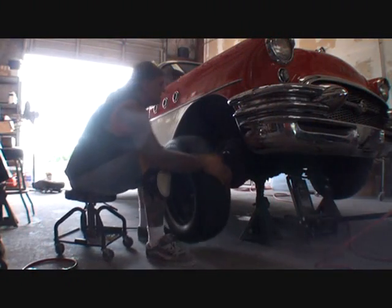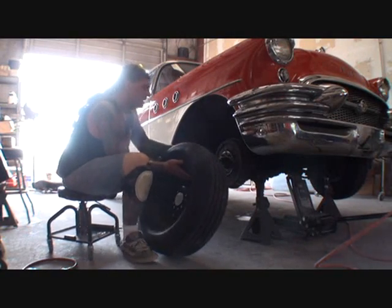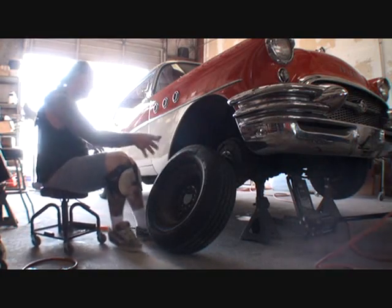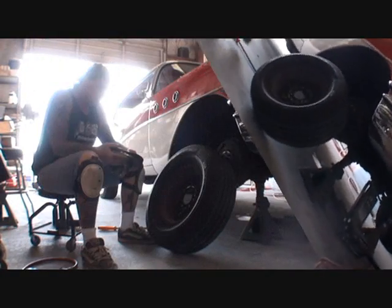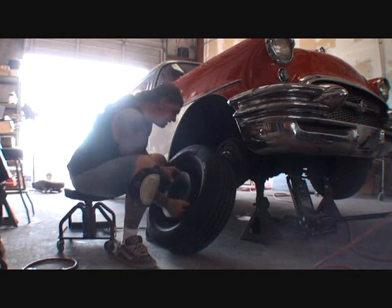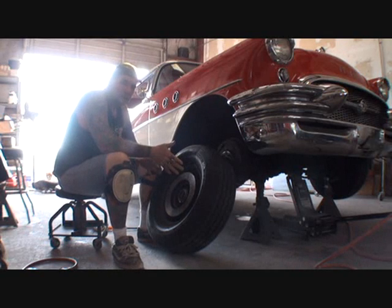So before we do anything, I'm going to turn that wheel around just like this, because if these are the wrong parts, I want to find out right now. I'm going to go ahead and make sure that this rotor fits our bolt pattern before we do anything else. And I see that it does — fits perfect. So far, so good. We're on the right track. Let's keep on going.